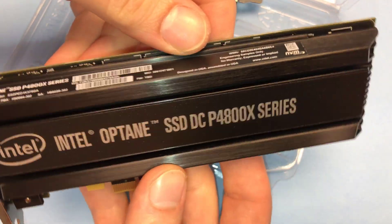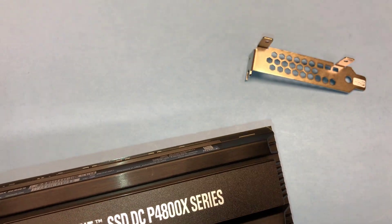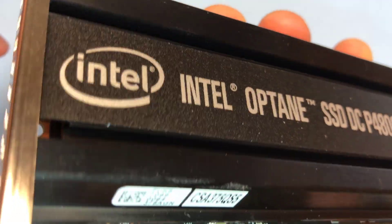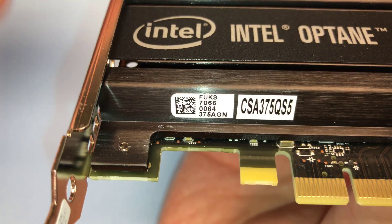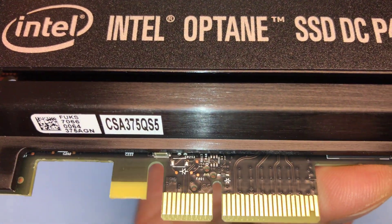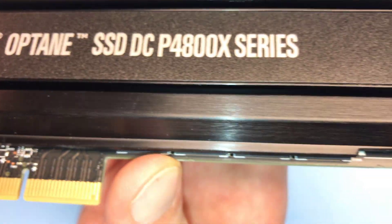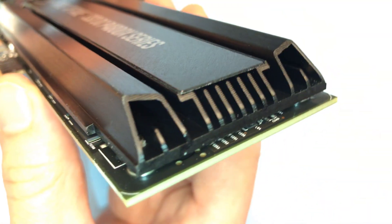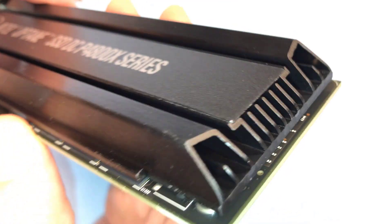Other people have worked on this — I see a little bit of evidence of that, but very minor — and I'm going to need the low profile adapter right there. Let's have a physical close look at all the pieces and parts. You'll notice the connector and the number of pins, indicating how many PCIe lanes. You're going to want a PCIe 3.0 slot, so a pretty modern PC, less than two years of age or so, to get the full speed out of this.